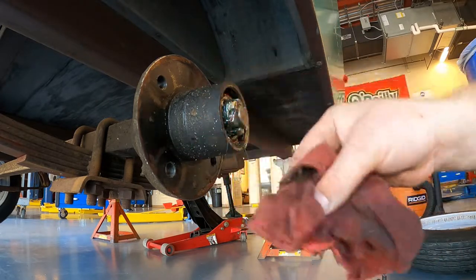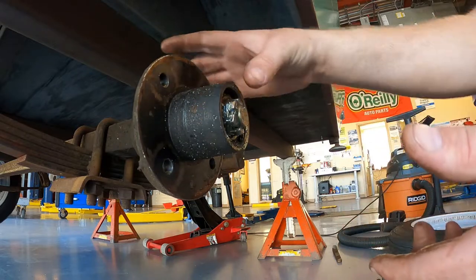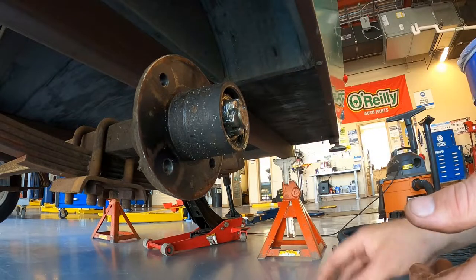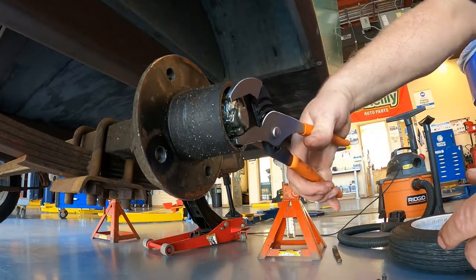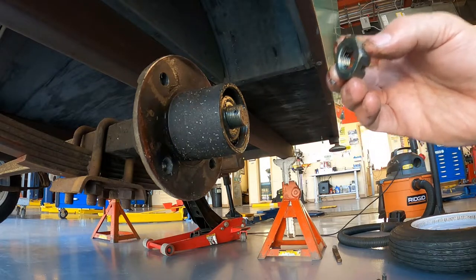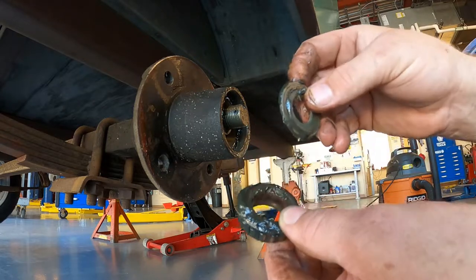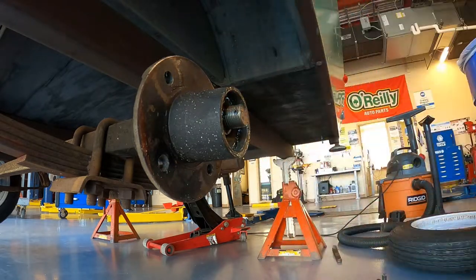The next thing we're left with is our hub nut. These aren't on terribly tight. This is a tapered wheel bearing set. The bearings on this trailer, as with most trailers, are both the same exact diameter. We still want to try to keep them in order because they have seated to the outer races in the hub and worn into themselves. Because they're tapered wheel bearings, there's not a tremendous amount of torque holding these hub nuts on, so we just loosen that up a small amount. We'll hold the hub nut to the side because we'll use it in another step. Our next two components are our outer bearing and the washer that seats against the inner race, which has a key to a keyway in the middle of the spindle. We'll put these in order on how they came off.